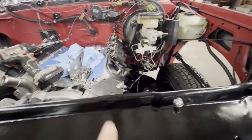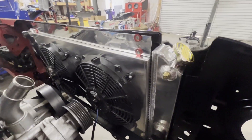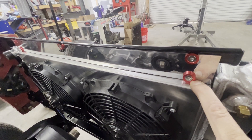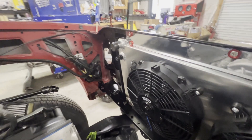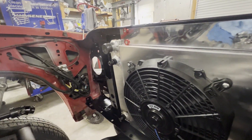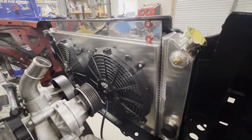I finished out the fill cap with that 7/64-inch tubing — it looks great. I'm probably going to go back and epoxy it on because when you start trying to take the cap off, you bump it and take it off. I filled in all the holes up here. When welding, you can take a piece of brass — put it on one side and weld to the other, and it will make a smooth finish on the other side. I got it all painted with some Rust-Oleum — Walmart, Lowe's, Home Depot, wherever. I did polish that piece of aluminum. I also used some wheel bumper bolt covers from my door panel video, which kind of gives it a little splash of color. I have AN fittings plugging off my oil cooler — that's an expensive plug, but it's what I had. I'll put those parts in the description.